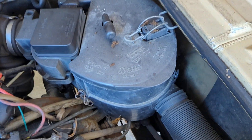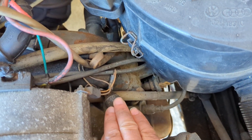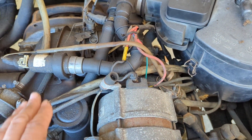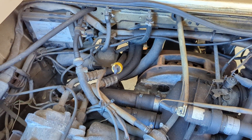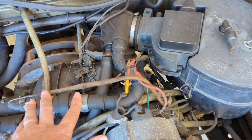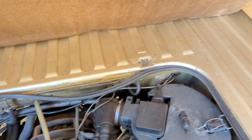There are also a couple of other pieces involved in this. Down on your power steering pump, you have a power steering idle-up switch. The unit takes input from this — when you turn your steering full lock, it will raise your idle to keep the engine from stalling. It also takes a reading from the temperature sensor for the fuel injection, and when the car is cold on a cold start, it's going to raise the idle for a while until the car warms up.